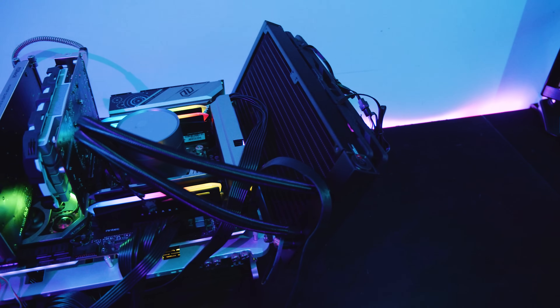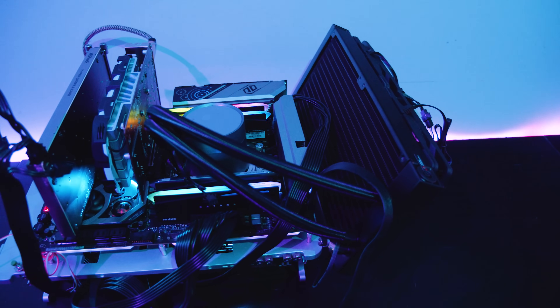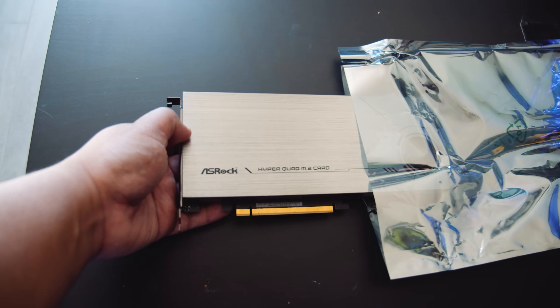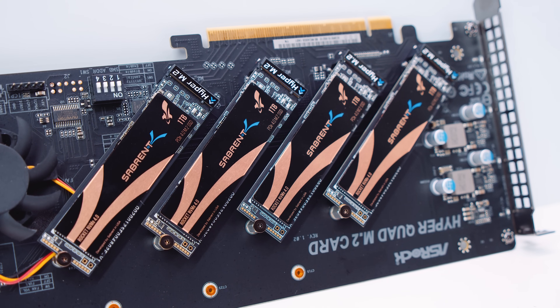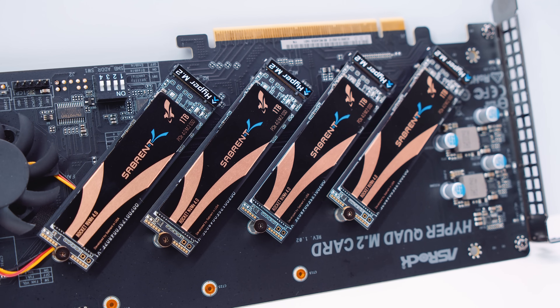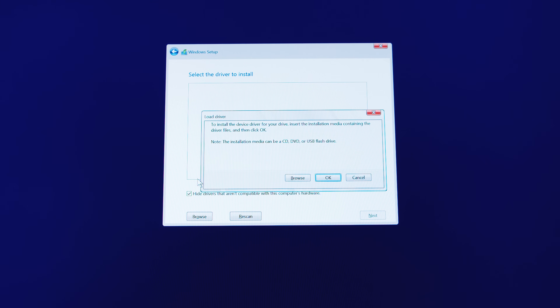Spoiler alert — it's absolutely ridiculously fast. The way this works is I used the TRX40 Taichi from Asrock, put the 3970X on it — the 32-core Threadripper — and used the add-in card that comes with the motherboard. I did test this on my editing PC with a Gigabyte board too. The best way to install the RAID driver is in the pre-installation environment, meaning you load the drivers during Windows installation. You actually need to load three drivers in a specific order for this to work properly.